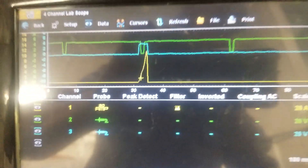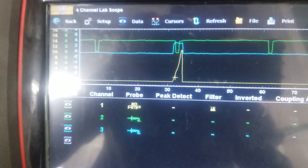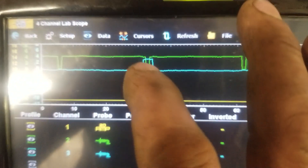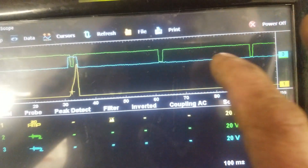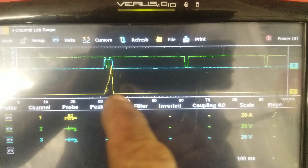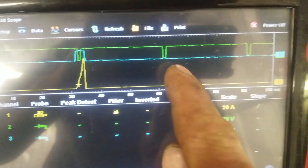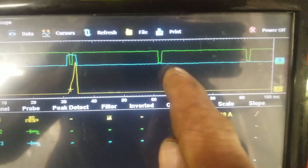You can see I've got that amperage waveform on cylinder six tied in — there's the amperage right there. The blue trace is our timing signal, and the green trace is our IGF feedback signal for all the coils. Pat had told me from Voltage Drop Diagnostics that I can get that from any coil and identify cylinders. The firing order on this is 1-2-3-4-5-6. So this is six, then one — that's the one we repaired — and you can see it's not dropping out anymore on the green trace.